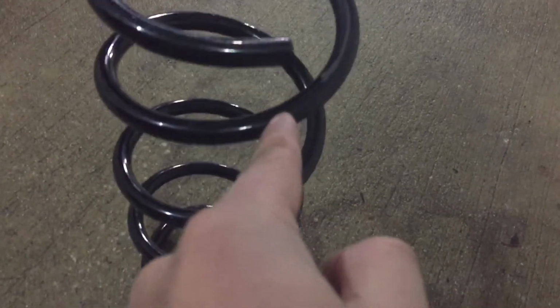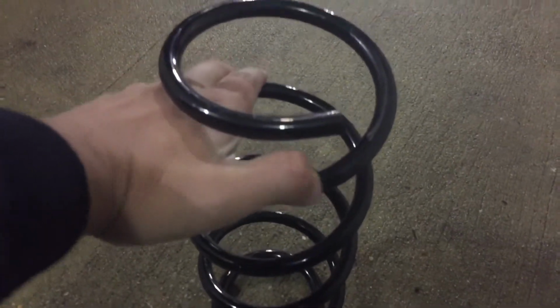But anyways, on our cars, like the Chevy Spark, the tail sits on top, and that sits on the bottom of the bucket. So, I'll explain how to cut a coil out of this. What you want to do is, from the starting point, measure directly down to right here. This to this point is one coil. So really, all you're doing is removing this section, and it's going to be exactly the same right there. You can cut to there, and it sits right in your bucket exactly the same.